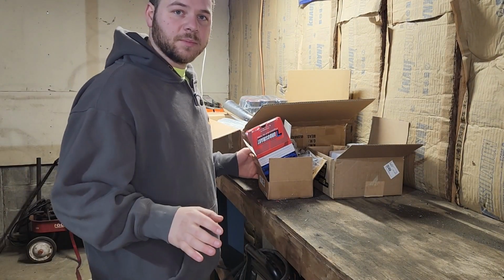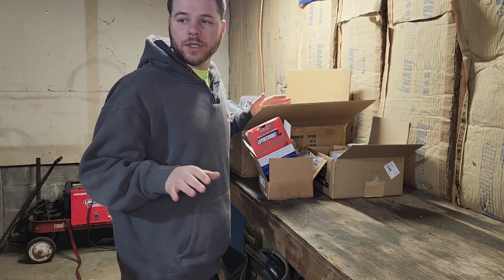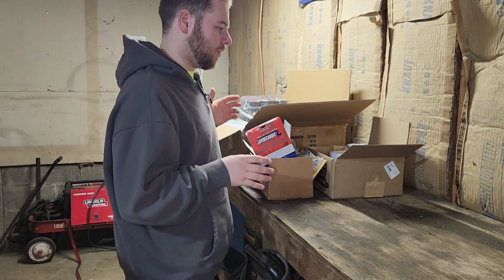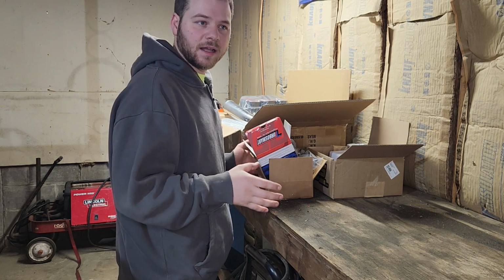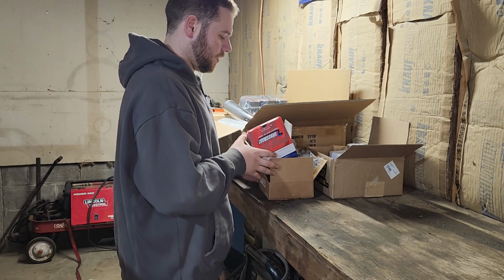So when it comes to building this cold side, with getting all the parts, you can only do so much guessing with the tape measure on the truck. So we kind of order the main fittings you need and then a bunch of miscellaneous clamps and bends, and then we'll make work and cut and weld what we need to on the way.